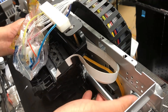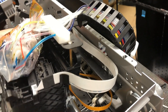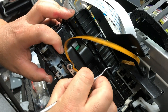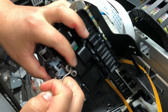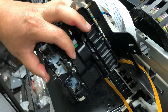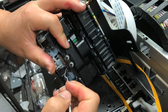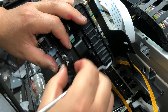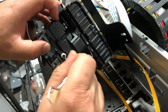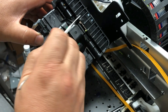Now you can see the rod. If you slide it to the left and lift it up, the whole thing comes out. We removed this eyeglasses-shaped thing. You can remove the belt later, but in this video I removed it first. So you lift it up from the left, put it down, and then it's unlocked and can be released. Now we can release the holding assembly by poking underneath and lifting it up. If you need the dental tool, you can go to my website and search for dental tool. There are also similar tools on Amazon, but you get a whole bunch that aren't suitable for fixing printers. I found this specific tool that's really useful for working on the printer.